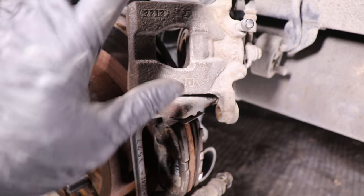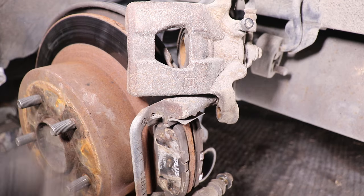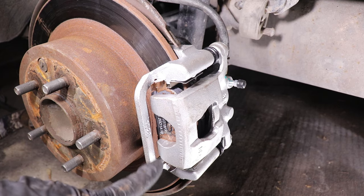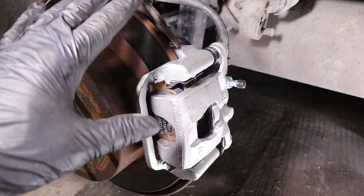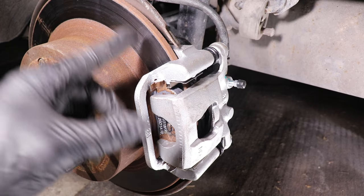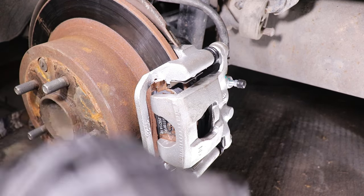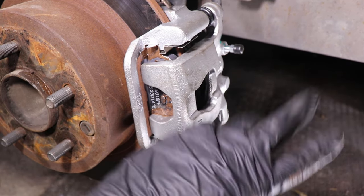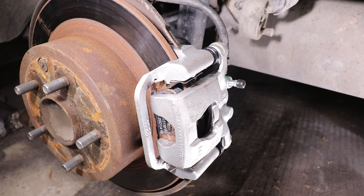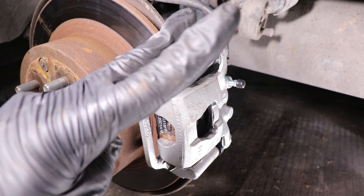If you're too late, sometimes it could chew up the rotor, but this rotor we could probably save. So now we're gonna replace the caliper and the brake pads with new ones, and that should fix our sticking caliper problem. The new caliper is on with new brake pads. It's gonna be your choice if you want to replace the rotor — some bad calipers can chew it up pretty bad if caught too late. Always make sure you bleed the new caliper you've just installed. Hope you find this video helpful — leave comments below, like and subscribe for more videos like these.